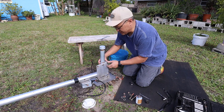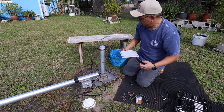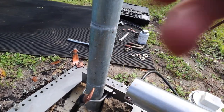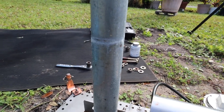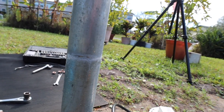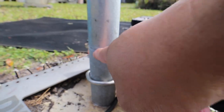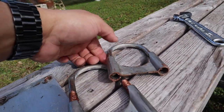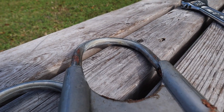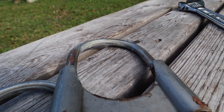The bolts come off easily because I have anti-seize on the threads. Let me show you some of the corrosion I'm talking about — right here, take a look at that white film. That's corrosion, and you can see a little bit of metal right there. I want to make a better contact with ground down here as well. I'm going to clean that up where they connect. I'm going to clean this up real well, and when I connect it together I'm going to put some anti-seize in there — it's almost like a corrosion preventative.